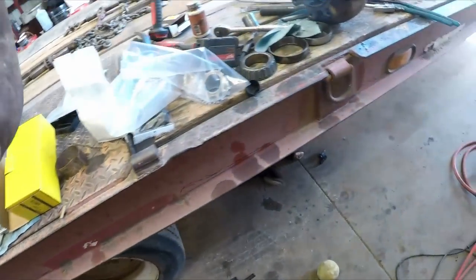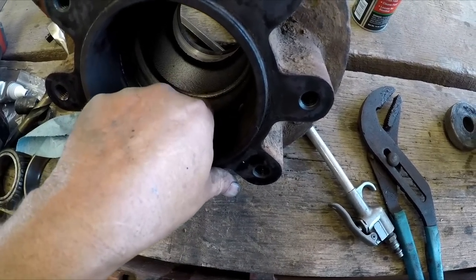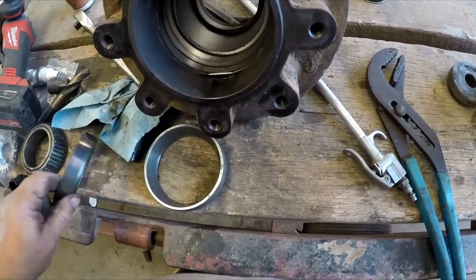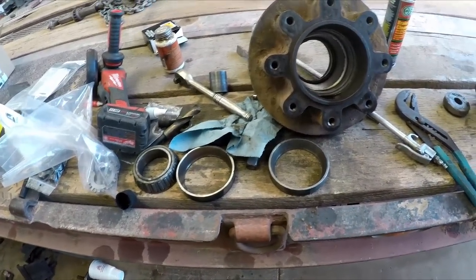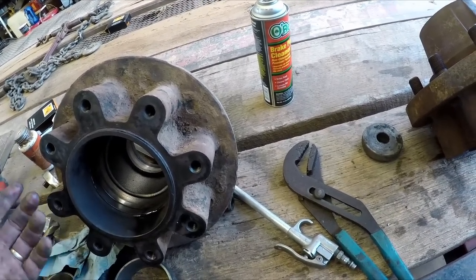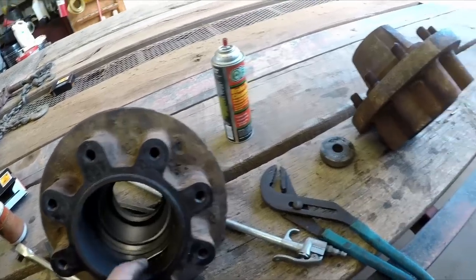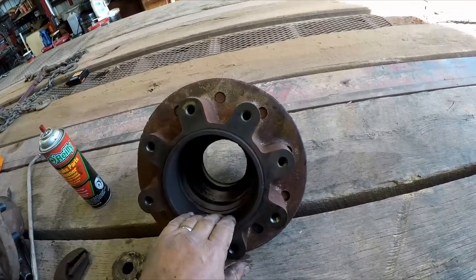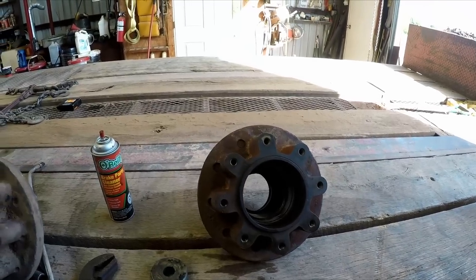Another problem I run into — I've got the old axle. This is one of the hubs, and this is where the bearing rides. You can see that thing has just been spinning. These hubs are not available anymore — they switched to a different style which is a hub pilot, eight bolt. I probably should have just bought a new axle, but I've got a hub off the old axle where I spun the bearings. This is the side that didn't spin the bearings, luckily, and this one has a lot less miles on it. I'll get it cleaned up and put the new drum on.